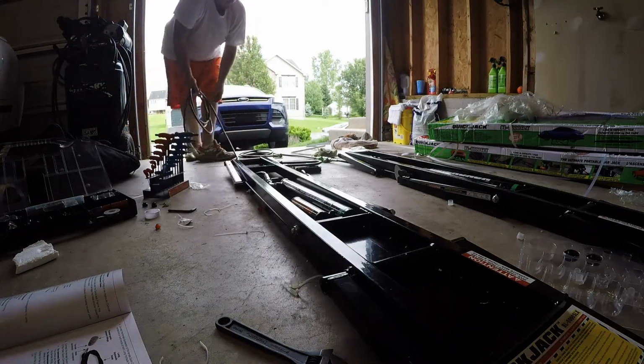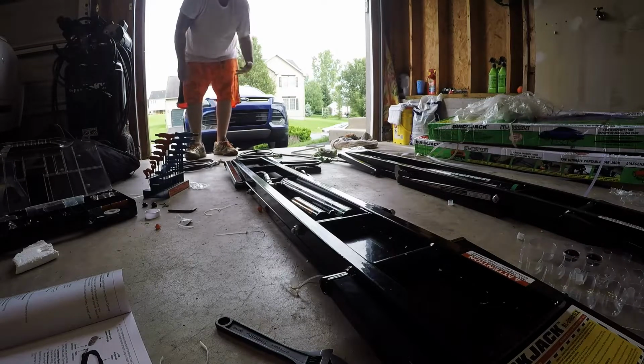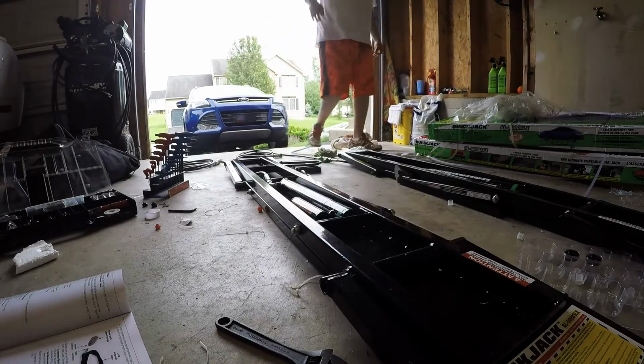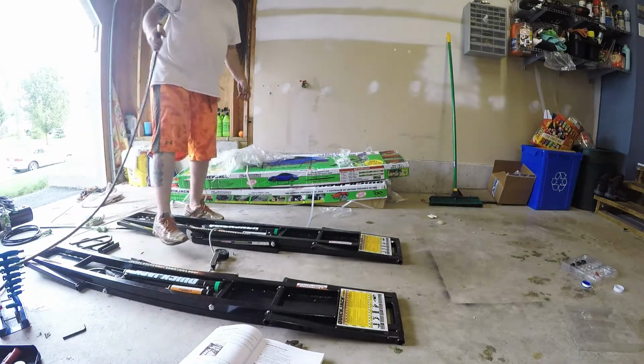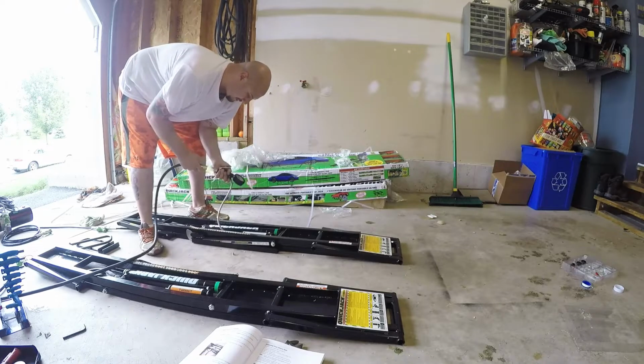Attached. And next thing you're going to do is hook these long lines up to the pump. I'm going to bring the pump down this way, even though my electric is on the back side of the garage. We're going to adjust some things around and get some electric down this way anyway. I already released air on one cylinder. It says to then pump them up with a compressor up to 40 to 50 psi.